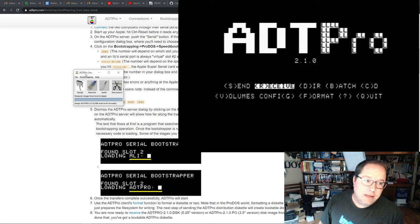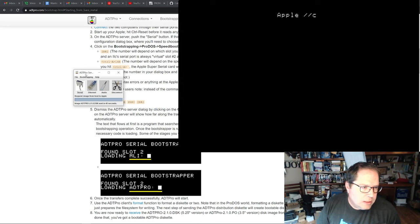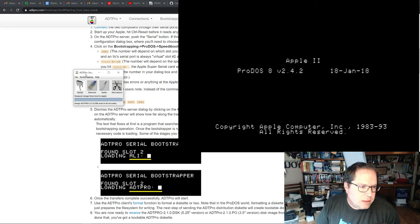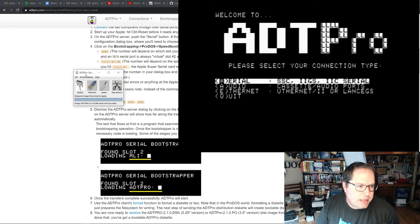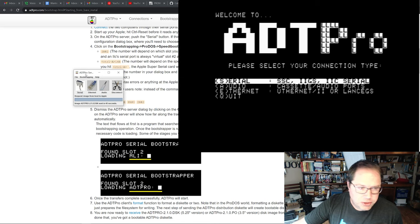It's all done and complete. I hit a key to continue and it takes me back to the menu. Theoretically we've written the disk image. The disk is still in the drive, so all I have to do now is hit Open Apple Control-Reset to reboot the Apple IIc, and it should boot off that drive. Sounds like it's reading the disk — and there we go, it's booting up ProDOS. We're into ADTPro this time from the physical disk that we just made. So now we've done our bootstrapping and we've got a disc we can use from here on out.